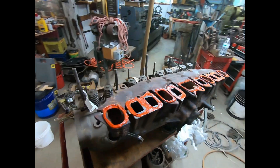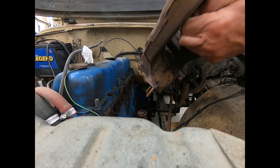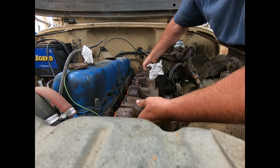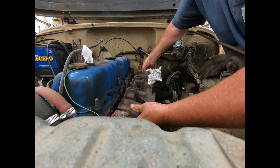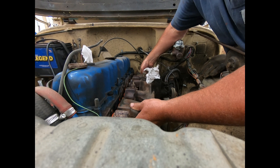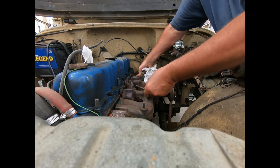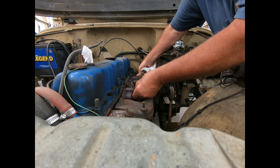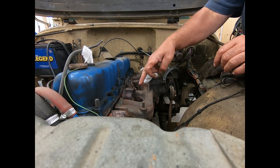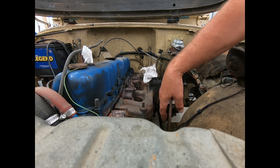So I'm going to go put the camera over the other way and we'll see what happens. Now, if we can get this in here, get that side on that stud. There we go. Now, what I'm going to try to do is pull this up even. I'm actually going to tap it because these intakes, it's got dowel pins on both ends. So I'm going to get me a hammer and do some tapping. I'll be back in a second.